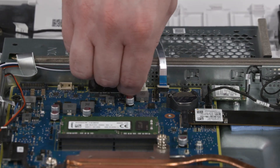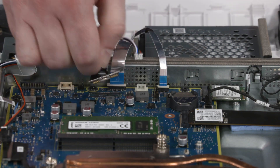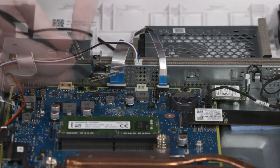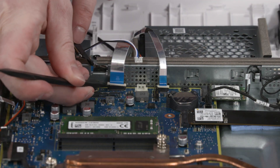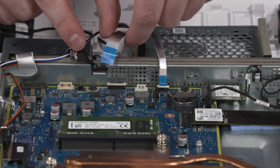Removal: Disconnect the speaker cable from the connector on the motherboard. Disconnect the audio board cable from the connector on the motherboard. Using minimal force, lift the locking bar up on the TV tuner transfer board ZIF connector and disconnect the ribbon cable from the motherboard.